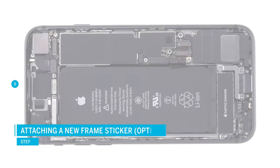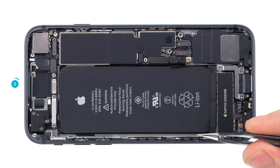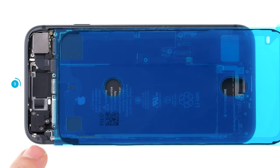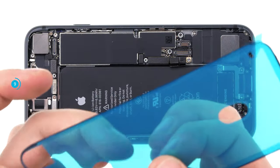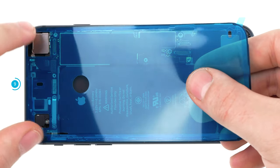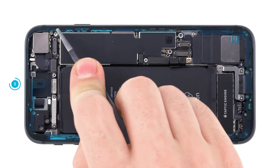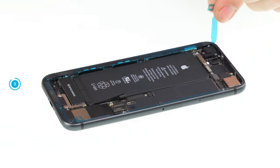To protect the iPhone against dust and splash water, it is recommended to use a new adhesive frame. The procedure shown here uses an iPhone 8 for illustration, but it is the same for the iPhone 11. First remove all glue residue so the new glue will hold, but remember the iPhone will no longer be 100% waterproof. Before attaching the frame sticker, make sure it's aligned right — the corners and the holes for the camera show which way is up or down. Remove the first backing film, put the frame smoothly on one side of the device, press it on slightly, then press the sticker all around. Make sure the sticker stays inside the frame. Use a spudger to make it hold properly, then remove the second big carrier film. You can remove the last small piece of film now or after connecting and testing the display — leaving it on prevents the display from sticking too early.